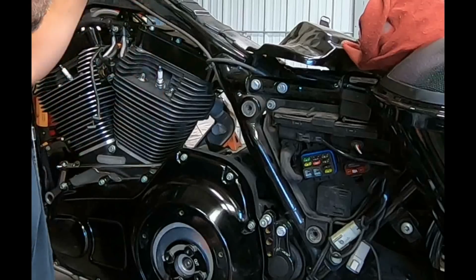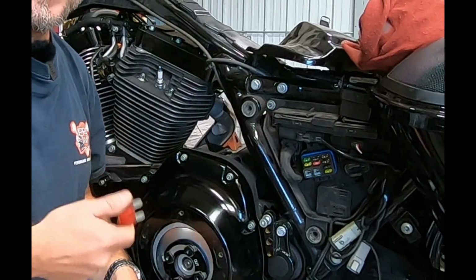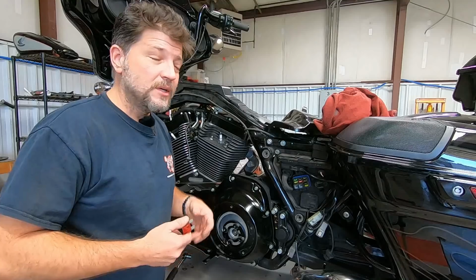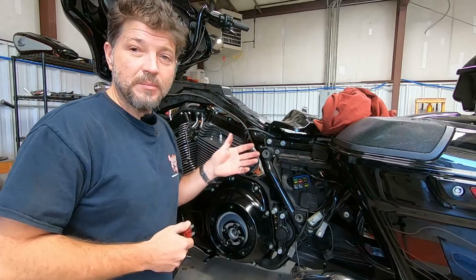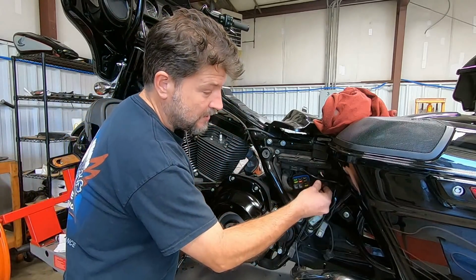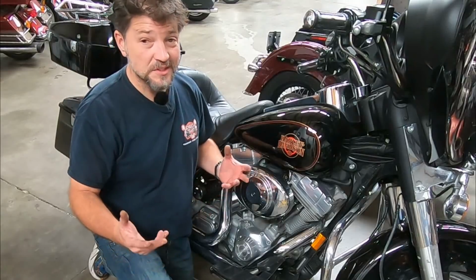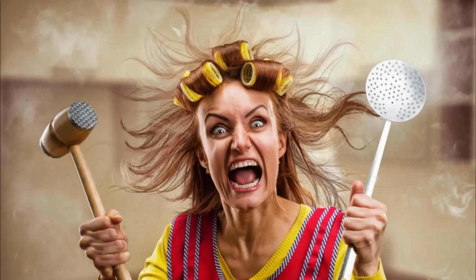Once it disarms, you flip the switch off, and within 2 seconds, you yank out the main fuse. That will completely disable the alarm, and will allow you to disconnect the battery and install a new battery. When the battery's in, you pop the fuse back in, the alarm system will arm itself, and you're good to go. Now this one's going to require you to raid your wife's medicine cabinet.